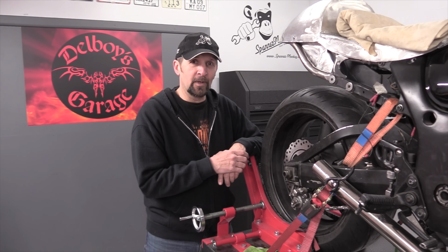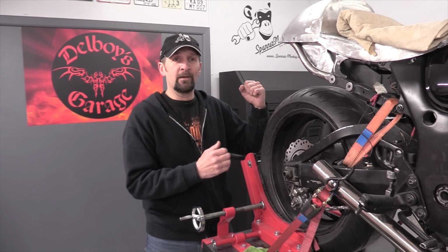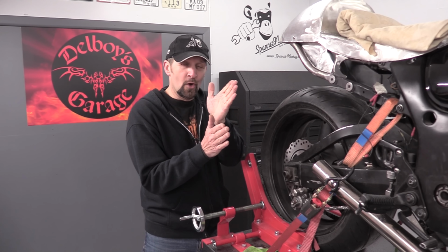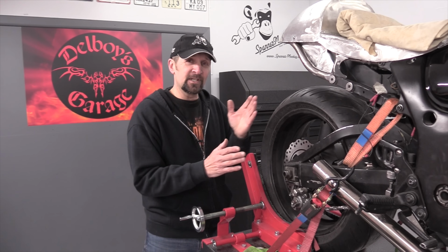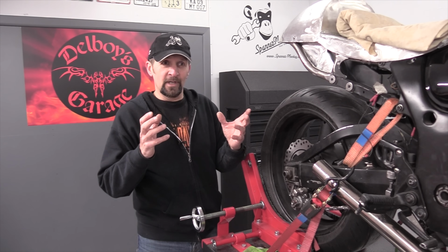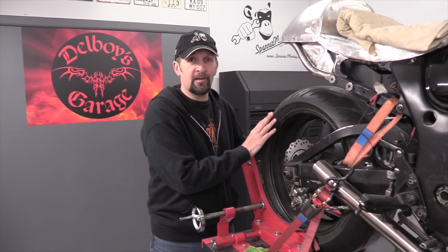When I've done damage estimates for motorcycles in the past, it is the second thing I check after the fork clamp, because most bikes at some point or another, they're gonna go down a pothole, they're gonna bop down a curb, they might even do a stoppie if they're a bit of a boisterous rider. Now those impacts on the back wheel constantly can knock out the alignment, and it just needs to be checked every now and again. And if it is misaligned by more than a few degrees, that will cause the bike to crab up the road very slightly. Not so as you'd visually notice it as it rides past, but certainly if you're noticing it in the bars, it is therefore worth a check.